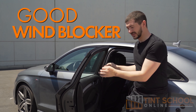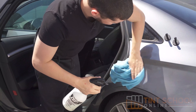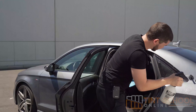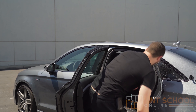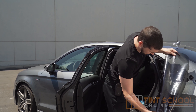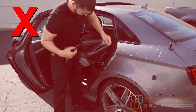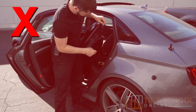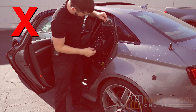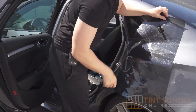I'm going to show you how to do it on the vehicle. The next step is to get our film and place it on the car where we're going to peel it — just remember to wipe the car down. When you're pulling the film out, if the wind is blowing you want to make sure you're pulling it on each side to stop it from creasing. If you try to pull the film out holding it with slack, you're going to get creases as the wind catches it, so pull it tight, put one magnet here, then put one magnet here.